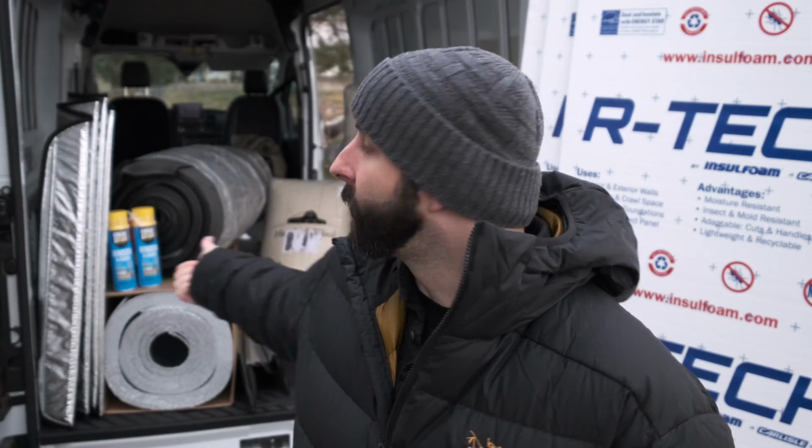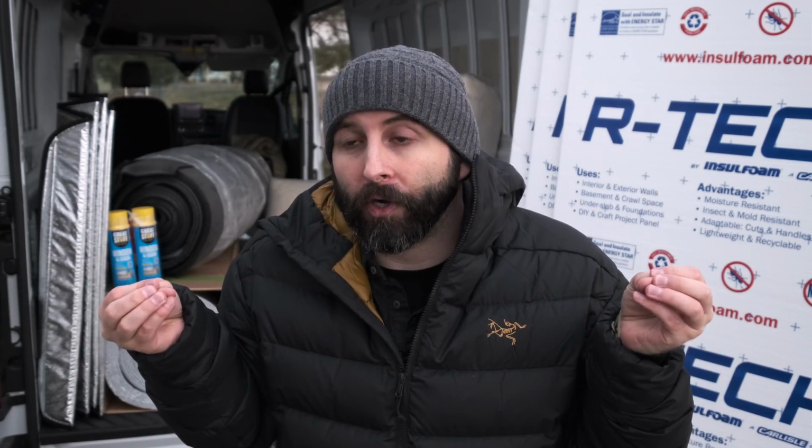That's why the surface that we're going to have against the walls is going to be something that can manage moisture very well. Hands down, nothing really does better than wool as far as managing moisture. Wool itself can actually absorb water when there's high humidity, and it'll take on that water and hold it. It can still retain 30% of its weight in water while keeping its same warmth rating.